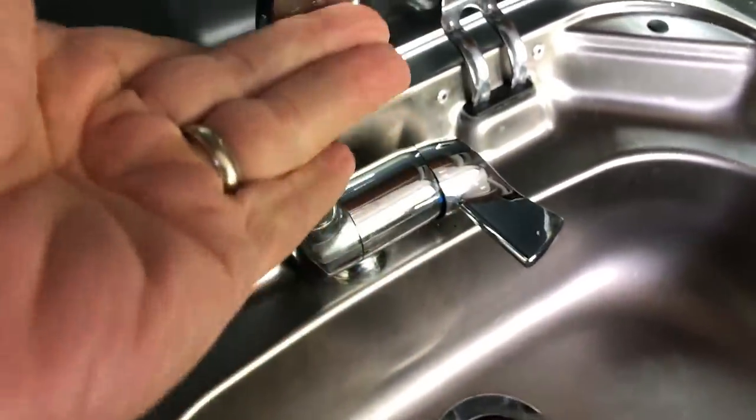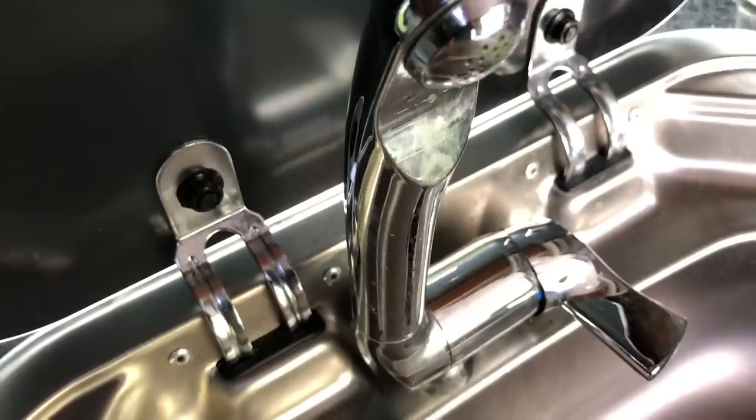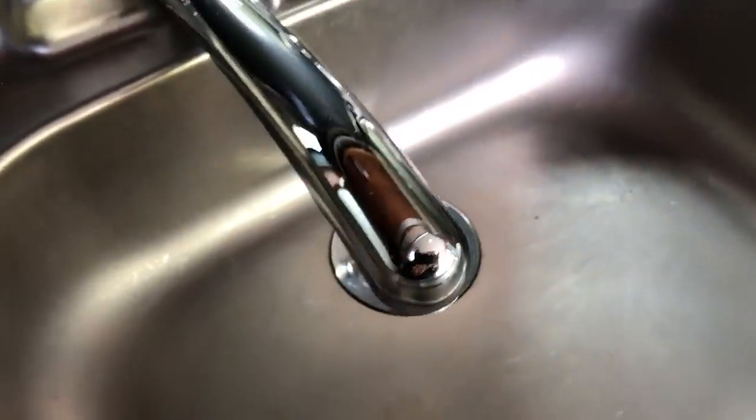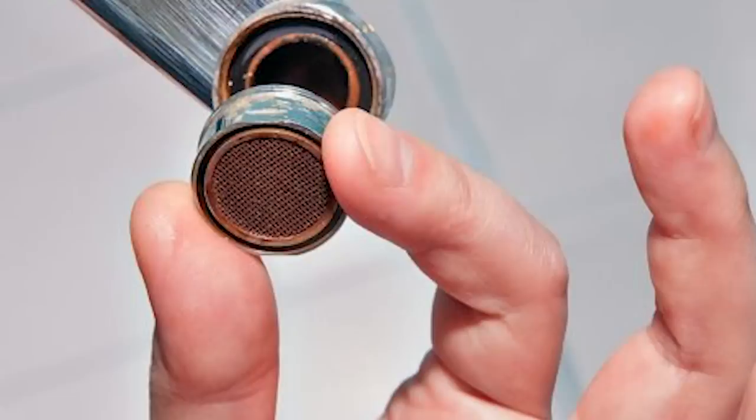What about at the kitchen or lavatory faucet? This problem presents itself regardless of how you're getting water pressure. If you're hooked up to city water and still experience low flow from your kitchen tap but not your bathroom tap, there's a strainer or aerator on the tap. Remove it and clean the screen to restore full flow. This is something we should do every year, or more often with heavy use. Hard water has an impact too — it forms calcium buildups on that screen, so those in hard water areas will require far more frequent cleaning.